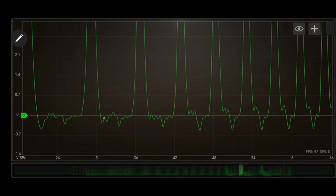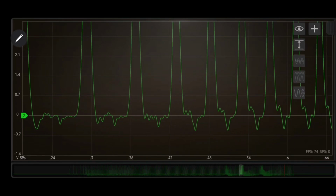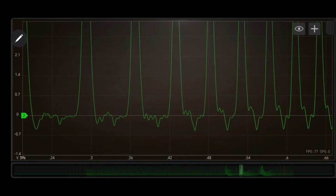Like I said, they should be a nice flat. They should actually come down, and they'll have some waves to them, but they should just ride right along here. If you see this exhaust pressure rising 20-25 psi or so, or even 12 or something like that, that's probably a sign of a restricted exhaust, whether that be a cat or something of that nature.